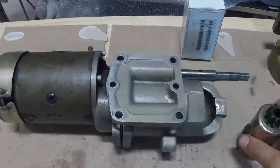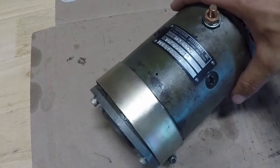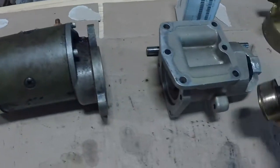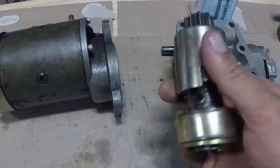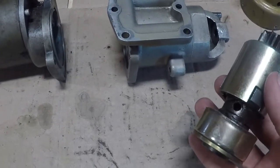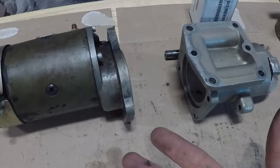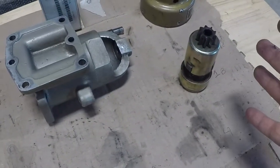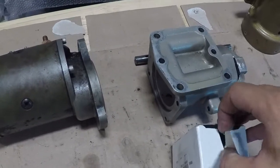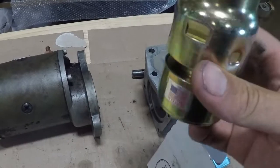This is a more expensive one. I've got this starter all apart here — this is a Prestolite MZ4206 starter motor, and the Bendix is a little more expensive on them, around the $300 to $350 range. Plus maybe an additional hour of labor — that's way better than a $1,700 or $1,800 starter motor. And let's face it, to replace the starter motor or to fix the old one, you've got to do the same amount of work. This other one is very common — that's why I keep this one in stock. Lots of 172s that have Prestolites use this one, and it was about $180.